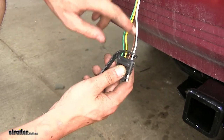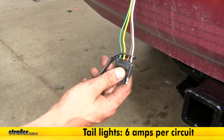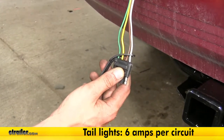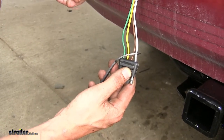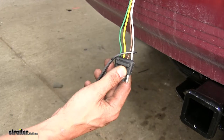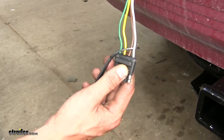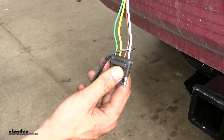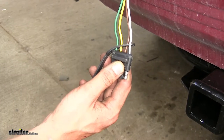On our taillight and running light circuit, we have a total power output of six amps. This is sufficient to tow a trailer regardless of how many lights it has. We should have enough power there to tow a trailer with even several incandescent light bulbs — that shouldn't be an issue. If we have LED lights, nothing to worry about there. There's plenty of power output for those because LED lights do require significantly less power than incandescent light bulbs.